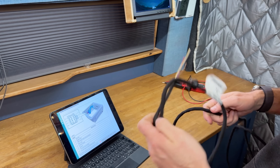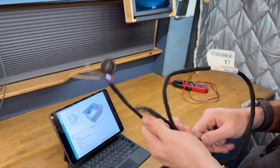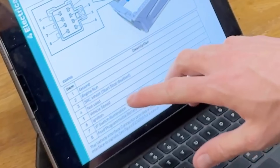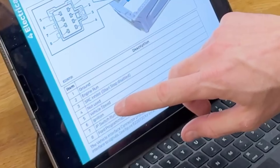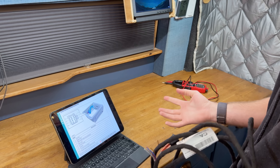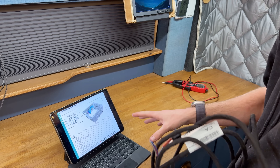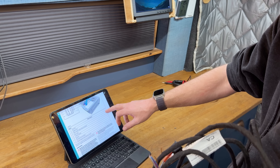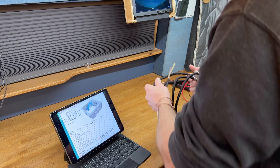I don't need to access it a lot, though if you wanted to you could run it nice and neat. For other people who might want to know the other uses: one of the pins is ignition-on, one is engine-run — which is quite useful for DC-DC chargers as well. I'm not entirely sure what IP switch illumination is. One's called vehicle speed — not sure how you'd use that; if anyone knows, do tell me. I'm not sure what Ford's programmable battery guard feature is either. Anyway, let's give it a quick test — there we go.